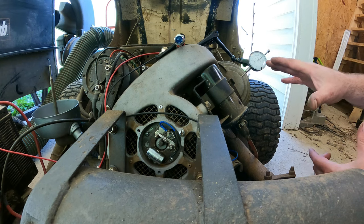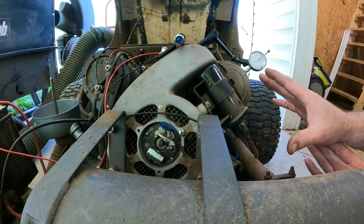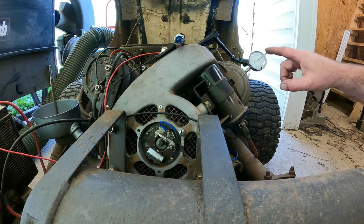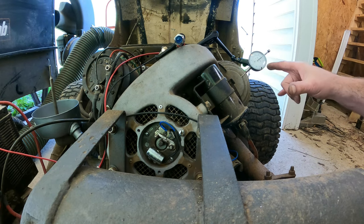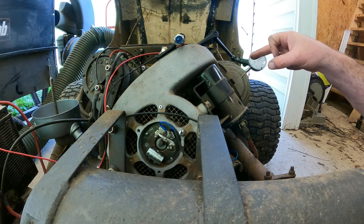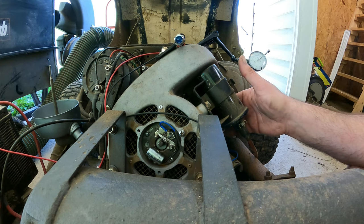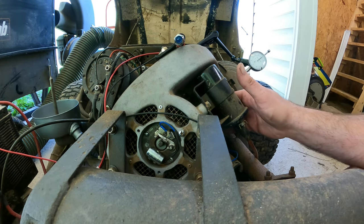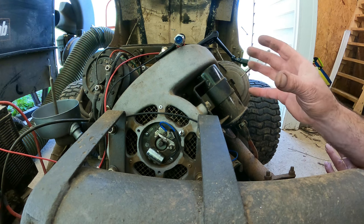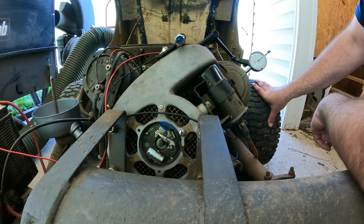I also got the idea of putting a dial indicator on top of the piston. Right now I'm sitting perfectly at top dead center. I counted out and it's 165 to 170-thousandths off top dead center where my lines line up down here, so I know the piston and the flywheel are in agreement. I was suspecting that could be an issue, but that was not the case. They are almost dead on — you have to give some tolerance for machining, but I did verify that.